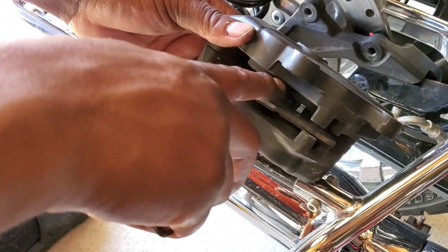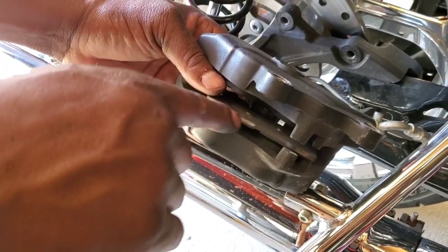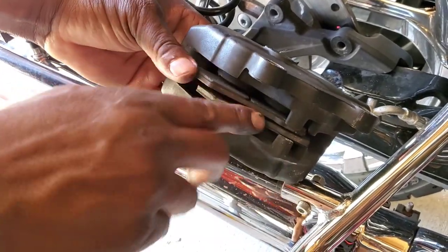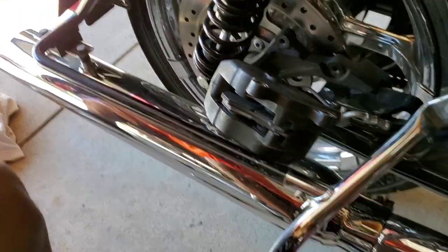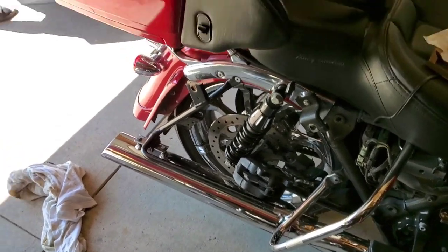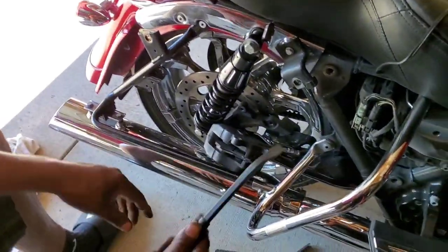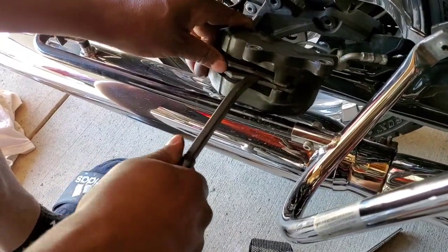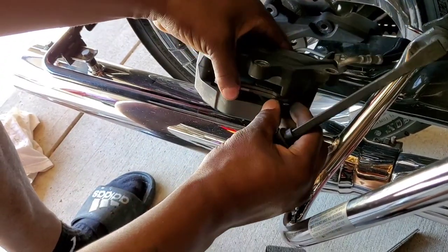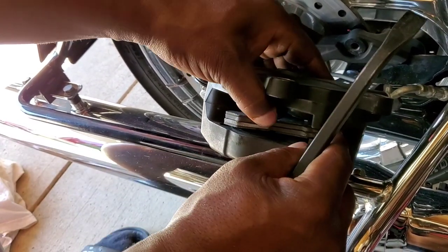You're gonna have to drive back both pistons on both sides. Two ways of doing this — I got a tool specifically for this in the other garage, but I'm too lazy to go get it. Or you could just leave both of these in there and take a large heavy screwdriver and try to push the caliper plunger back in there.